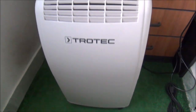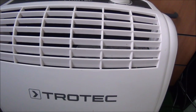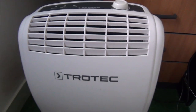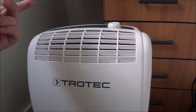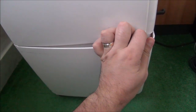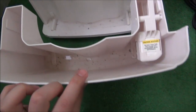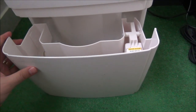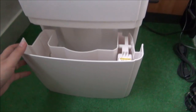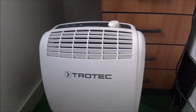Okay, it's been running for about half an hour. Let's see what we get. You can hear the sound of the compressor shutting down - basically it's the gas, not only gas, it's actually liquid moving through the pipes. Both sides - yep, and we have water! The humidity is really low in this place, so it's not abnormal that this is the only amount gathered in half an hour, but it is clearly working. Next, this is going to be cleaned.